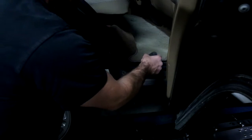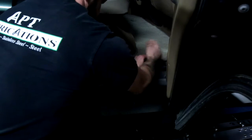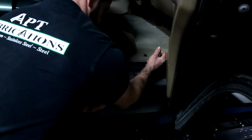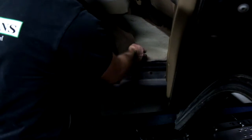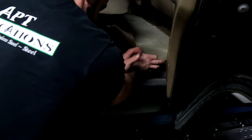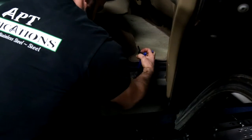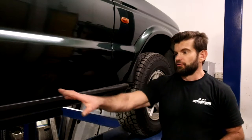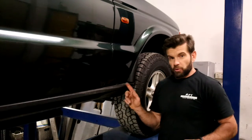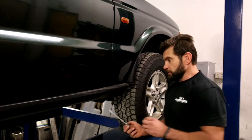And now we've got to pop the clips all the way down towards the front. This is where I use the flatty and then the side cutters. Once you've removed all the internal clips, there's one more sneaky little bolt down here that you need a 10mm socket for to get off. So we'll sneak under there.